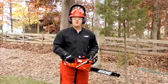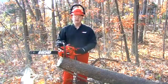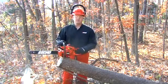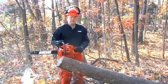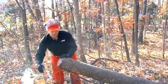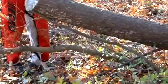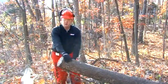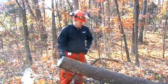So next, let's talk about correct operating procedures. Hi, I'm Dan with Echo Incorporated with a video series on how to use and maintain your gas chainsaw. So today we're outside and I'm going to show you the proper techniques in using your chainsaw. But before we do that, there's a couple things we need to do. First, we need to clean our area of any debris or logs that the log may fall on when we're doing our cutting. So we'll need to remove any obstructions on the log that we're going to cut and then clear away just the general debris around our cutting site.